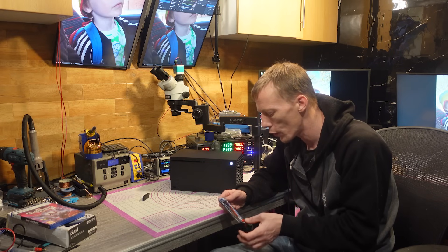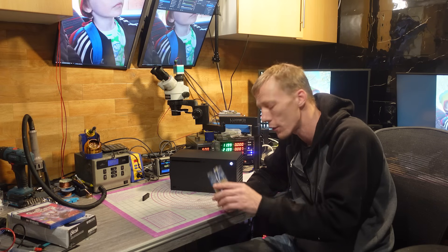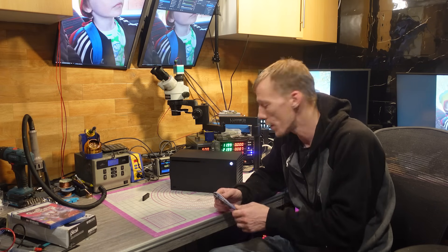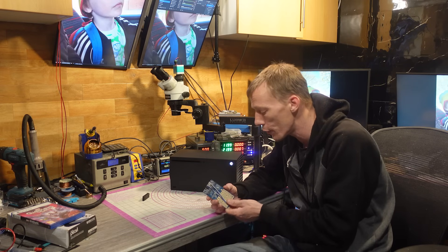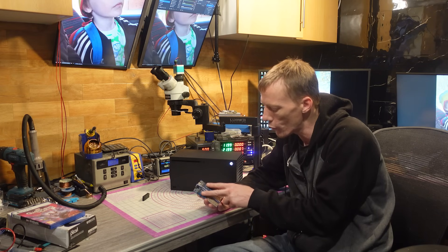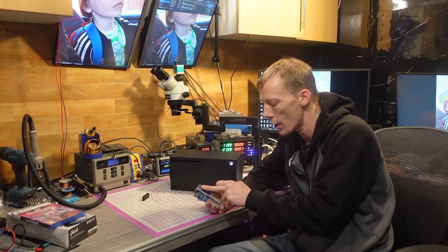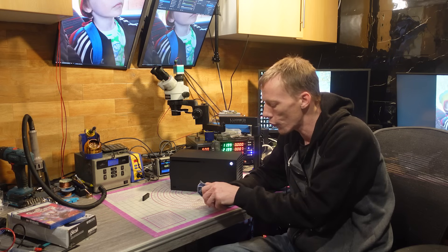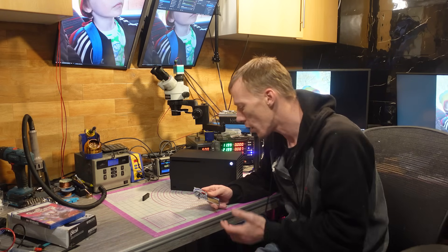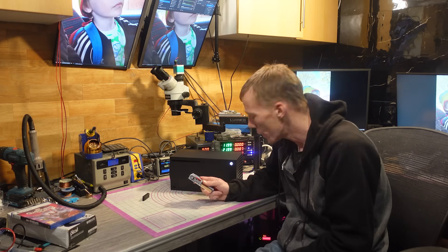This cloning device — I don't have the housing to mine anymore, I took it apart because it died. It does normally come with an aluminium housing. It's an absolutely fantastic bit of kit. You've got two slots — one for the source drive and one for the destination drive. You just plug it in, press and hold the button and it'll clone. That's the only way to get the data off it that we need for this console to boot. I'll leave a link to it in the top pinned comment.